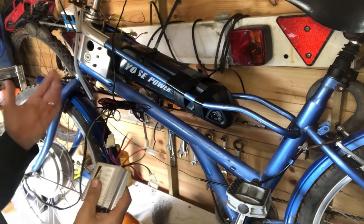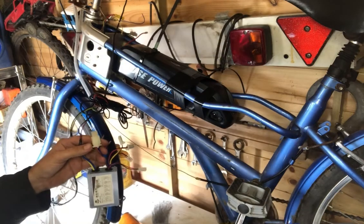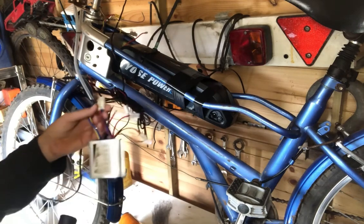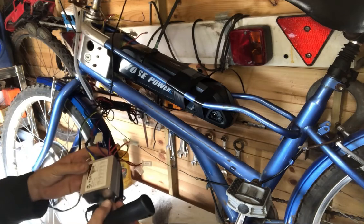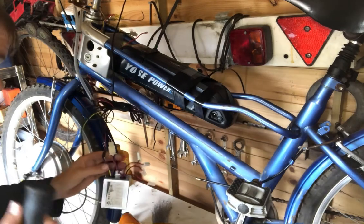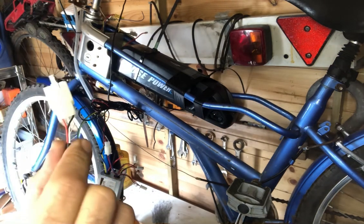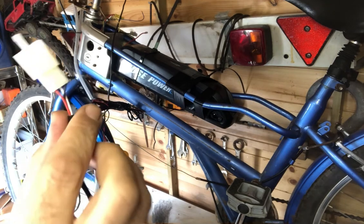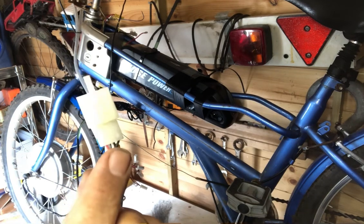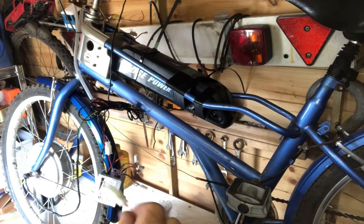You can wire them into the ignition and it'll work on and off as it should. But when I first put this on and plugged in the battery, nothing happened. So I went and purchased another speed controller thinking it was that — same again, nothing happening. When I looked closely, the wires on these plugs are supposed to just plug straight on and work straight away, but the red was actually going to the black on the bike and the black was going to the red. So I swapped them around, plugged it in, and it worked straight away.